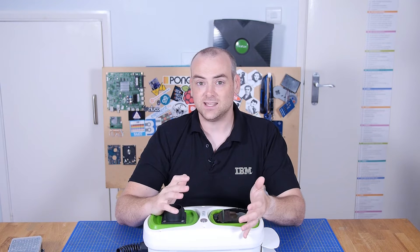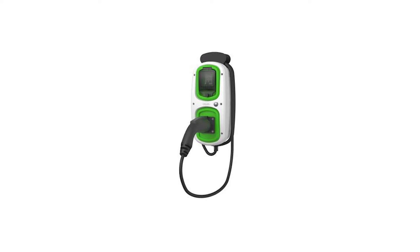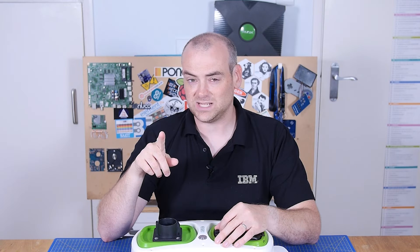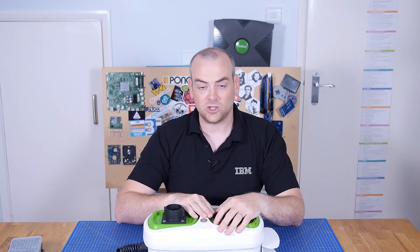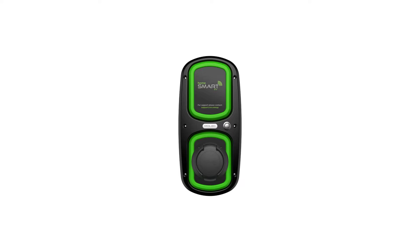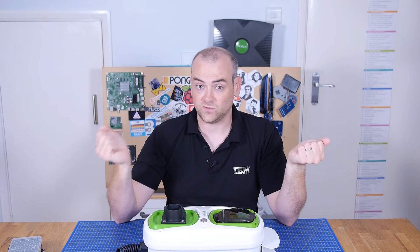There are two types: tethered and untethered. Tethered basically means you have a cable that is hardwired to it, with a socket on the end of the cable — and it's not a plug because it's the female receptacle. The untethered type is where there is a socket hard mounted to the wall and you would use a cable to connect it to your car. That cable would nominally be a male to female cable.